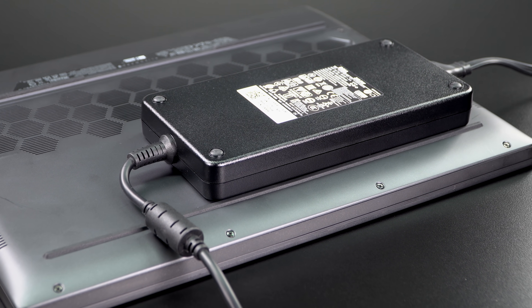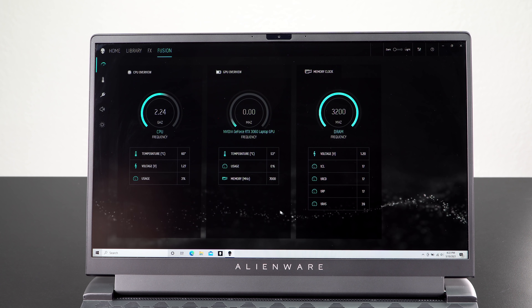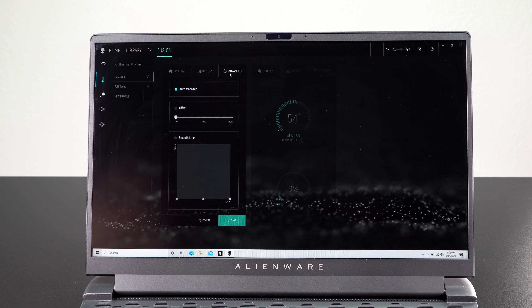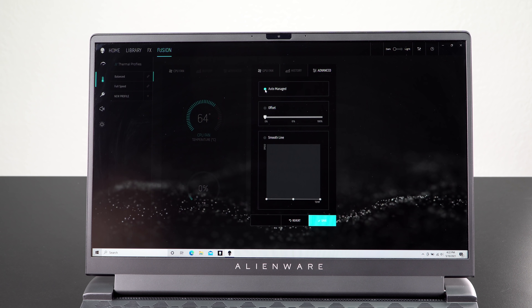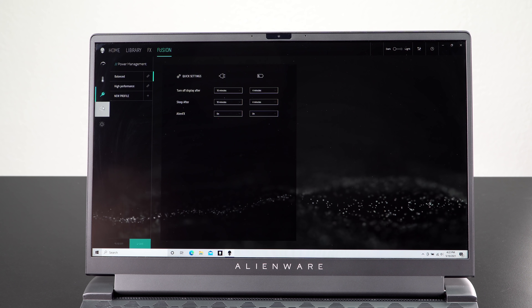The laptop ships with a big 240-watt adapter that Alienware has been offering forever — it's not the lightest and has a pretty big footprint, though it's not very thick. With the M15 R6, Dell said they're going to introduce a more compact 240-watt adapter. The good news is with an 86 watt-hour battery and Ryzen inside, battery life is pretty good in switchable graphics mode using the AMD Radeon Vega iGPU. Six and a half to eight hours if you're running in silent mode with brightness down. We ran it at 200 nits doing office productivity, streaming, and some Photoshop, getting about six and a half hours. For a gaming laptop, that's not bad.